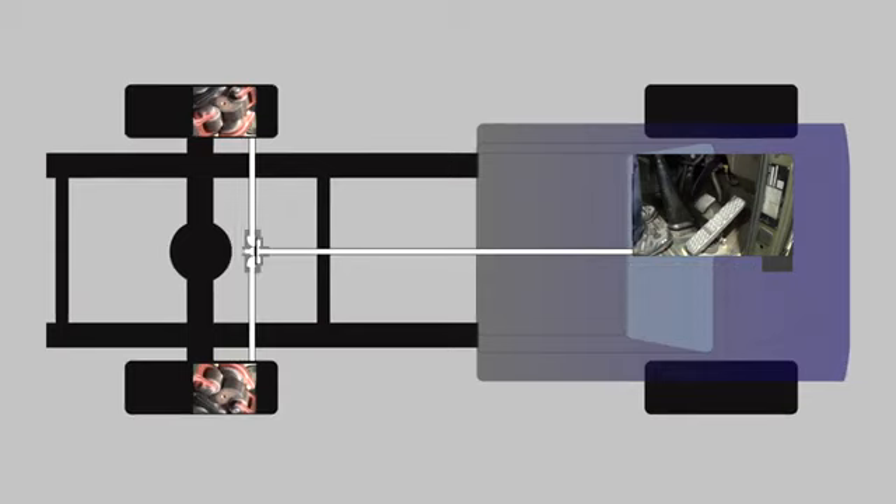What we've done here is put quick release valves near the axle, close to the brake actuators. When the driver applies the foot brake, compressed air travels down through the quick release valve to the actuators to apply the brakes. When the driver releases the foot brake, the air only needs to come back as far as the quick release valve to be exhausted — it no longer has to travel back up to the foot control valve. So when the driver releases the pedal, the brakes release much quicker, and that's how we've solved the problem of the service brakes not releasing quickly, and where the quick release valve gets its name.